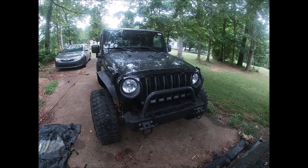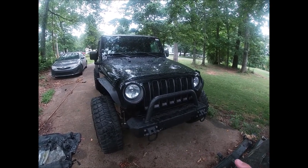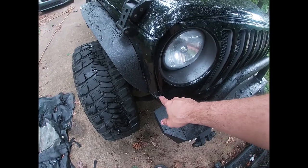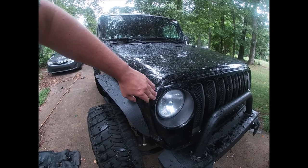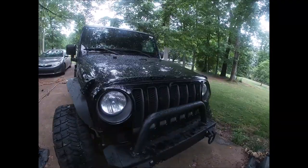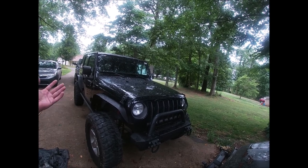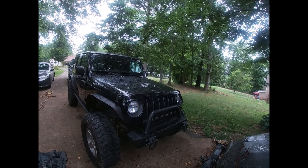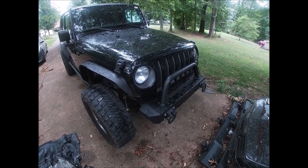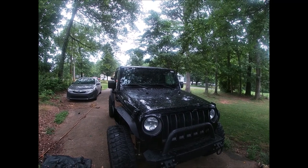Guys, here's the finished but extremely dirty JK with the JL grill. It has now gone about 800 miles between going down to Florida and back, and it's done great. The fitment issues are still there, but you can't really tell on a black vehicle. I'm going to put some body filler in here and sand it down and paint it black so you won't notice it. I wound up painting the bezels gray to match the rings and inner fenders — it looks good with the new flares, everything fits really well, and the Jeep looks great. So guys, there's the answer: can you put a JL grill on a JK? Yes, no, maybe — it just depends on what you want to do and what you can live with aesthetically. You might be a lot better at this body work than I am. I hope this video helps you make a decision on if this is right for you, or if you just want to wait on an aftermarket version. Thanks for watching — if this helps you, please hit like, share, and subscribe, and have a great day.